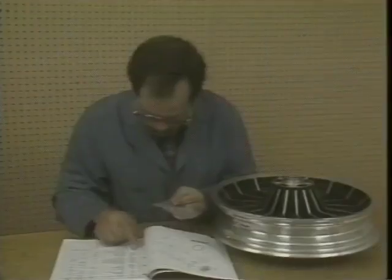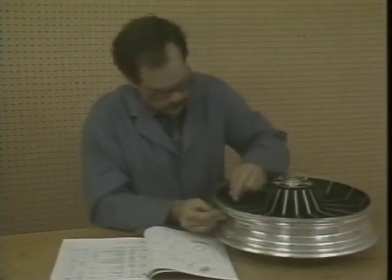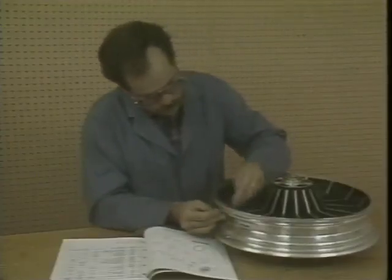Stem length is determined by brake caliper clearances. It is a good idea to replace the entire valve stem assembly whenever a tire is replaced. Just refer to the current parts catalog to ensure proper stem selection. When considering tire repairs, such as plugging, follow the tire manufacturer's service recommendations.